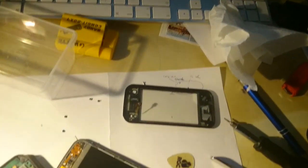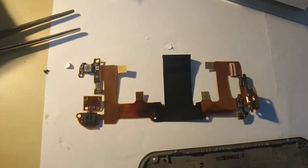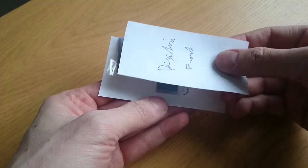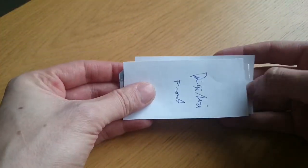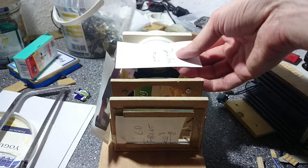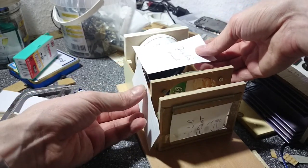In a first disassembly session I took apart the phone, guided by the original Nokia disassembly guide. Then in a tedious process that required bending the frame, heating up the display, and carefully pushing glue out of the way, I managed to dismantle the display module. All I need is the panel. In a much more tedious process I managed to get out the flat ribbon cable which was glued onto the metal housing — it has numerous fragile SMD components and was a pain to get out. To figure out how to arrange the parts without bending cables around, I made a paper mock-up of all parts with connections at the right places, and moved it around until I found a position where the screen is where it belongs. In my setup the panel is upside down and the light passes from the front to the back — otherwise the picture on screen would be mirrored and flipped. I figured I can place the touch screen on top of my box; I don't need the keyboard to control the phone.